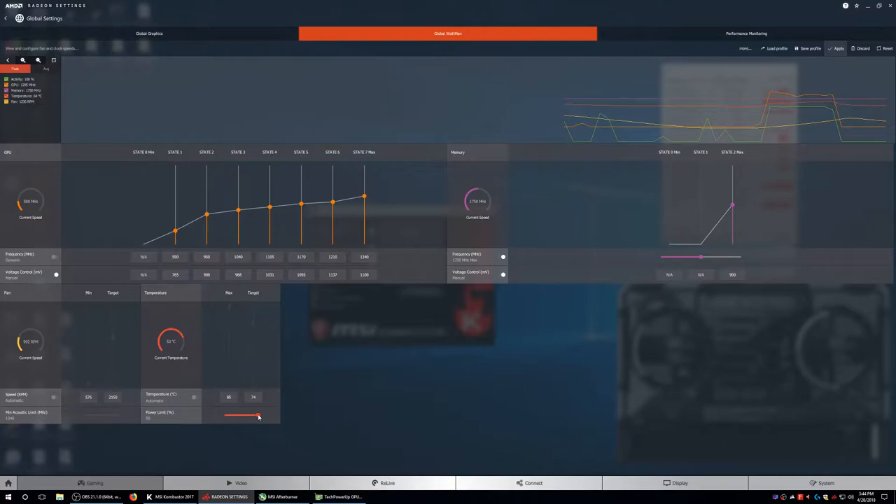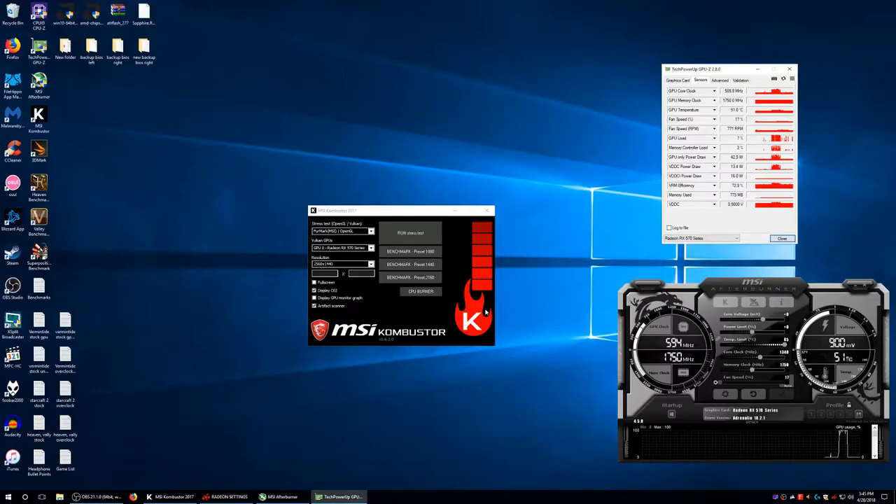So now that I'm able to go to 50, if I were to overclock to 1450 again I should definitely be able to keep that. That's perfectly safe to slide all the way to the right. Upping the power limit let me go up. Voltages are at about 1100 mV and power consumption didn't go down. I'm not seeing any artifacts.